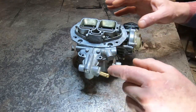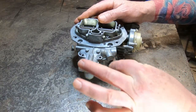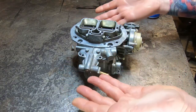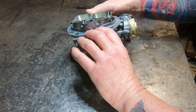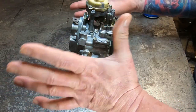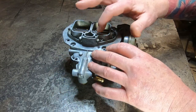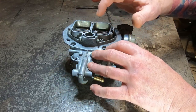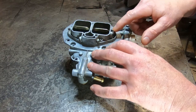All these carburetors are basically the same. The only difference between yours and this one is yours has a vent port coming off right here, but it's the same carburetor — it's the 32/36, this one's a DFAV. Your choke looks fine; this part manipulates the choke.